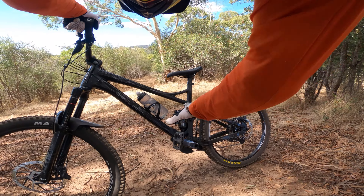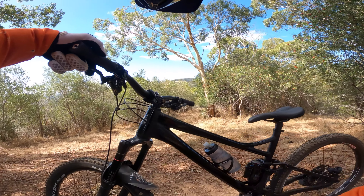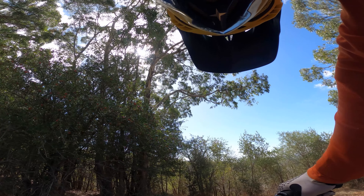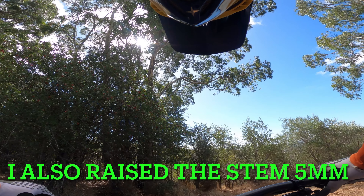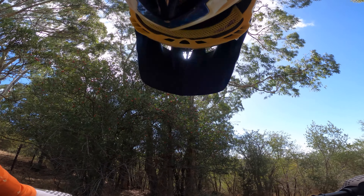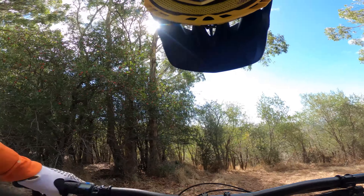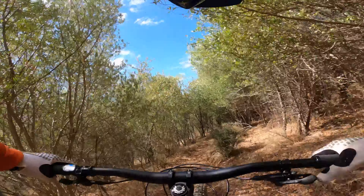The rear is basically the same — I've gone 130 in the rear from 132, so pretty much the same, just a little bit more. I didn't bottom it on that hit. The fork I've gone down 2 psi — sorry, 94 so 3 psi down — and three more clicks of compression just to take a little heat off the spring itself and fill up that gap I've opened, because the spring was just a little choppy off the top. That gap I've opened I've filled with compression for more control — more resistance going through the control mechanism instead of the resistance mechanism which is the spring. I've also sped the rebound up a click at the rear.